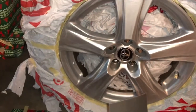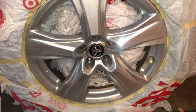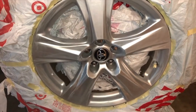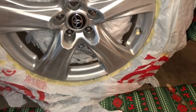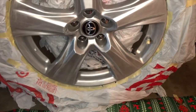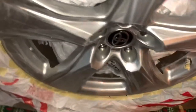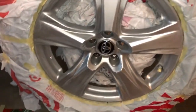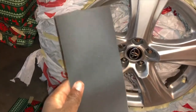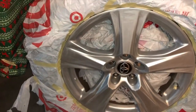I sanded this surface down — fairly new rims, less than two years old. But I still sanded it down so that I can make sure the paint and primer sticks. That's important. I'm gonna sand it down a little more just to make sure all the rough edges are cleared out. My air valve is covered up with some tape and I'm also going to cover up the little Toyota sign with some tape. The lug nuts — some people cover those as well, but I'm not going to do that.